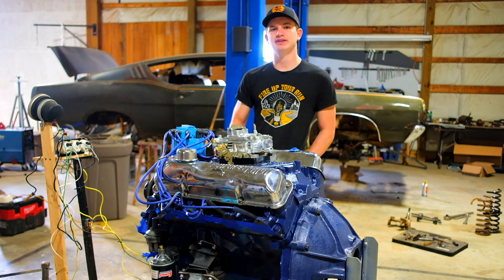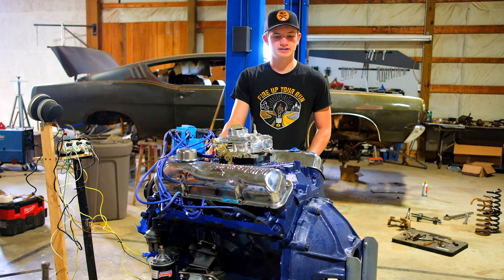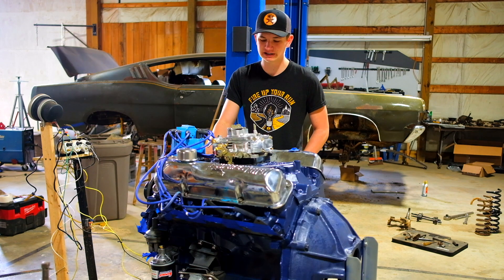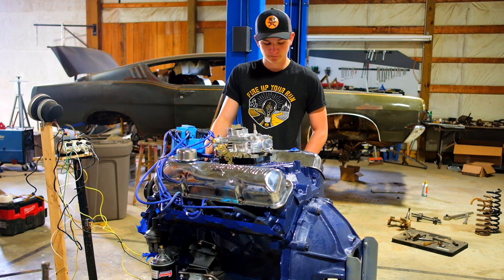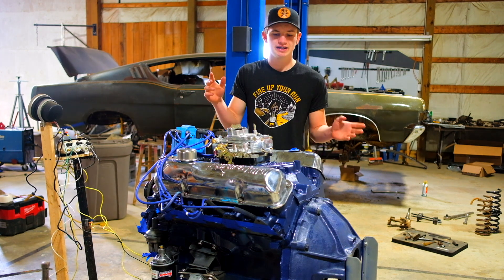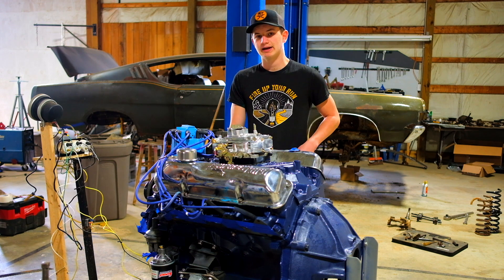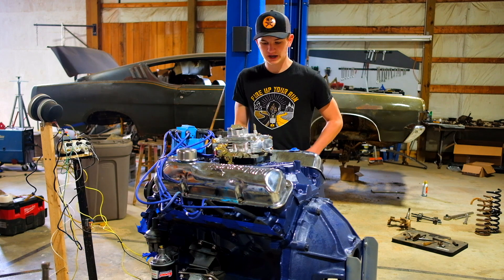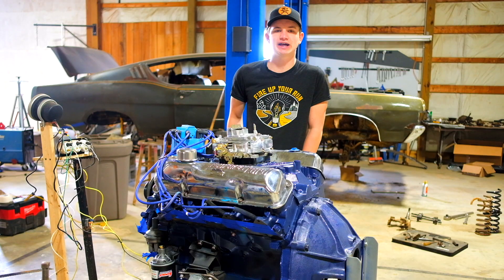If you guys have any thoughts about the output numbers I'd be curious to know. These are C8AEH heads, which are not the same as the heads that came on it — those would have been 390 GT heads, like C7OE heads I believe. The Ford FE casting numbers are all over the place. From what I understand, the C7OE heads and C8AEH heads differ only in valve spring rate. We actually put slightly stiffer springs on these than factory spec calls for, so that should have made a little more power. But it's all just theoretical really — made good torque and good horsepower and I'm more than happy with it.